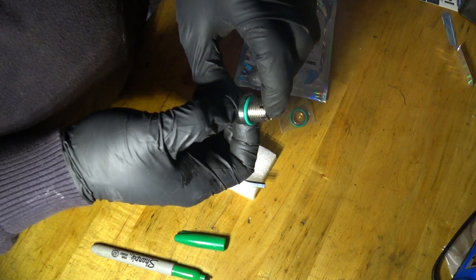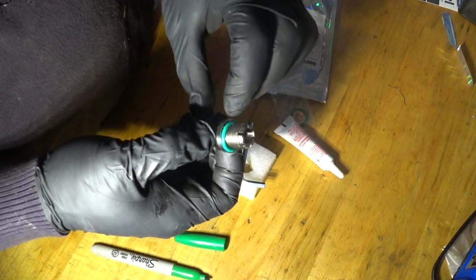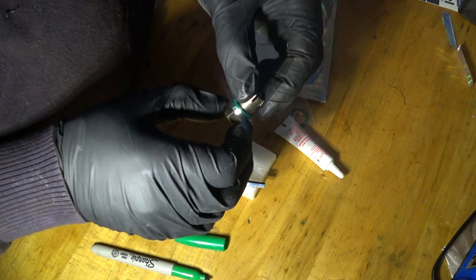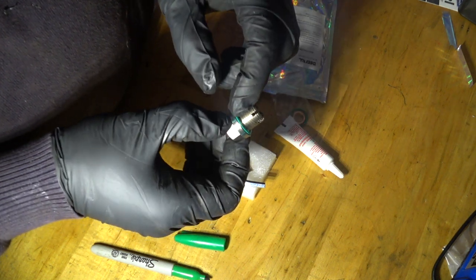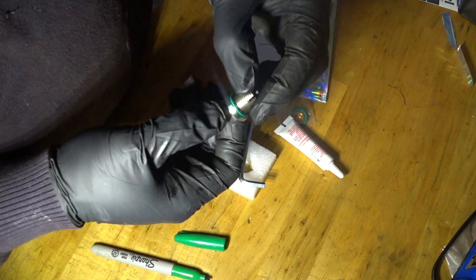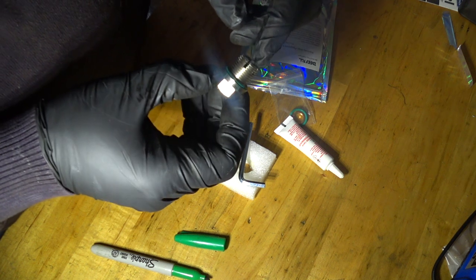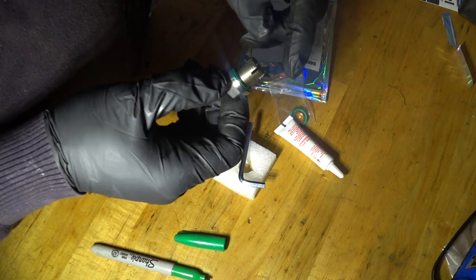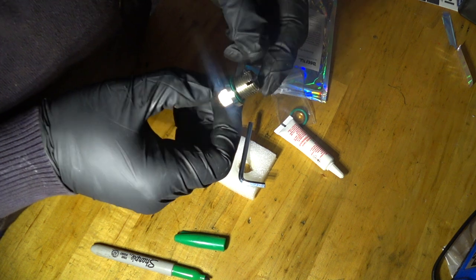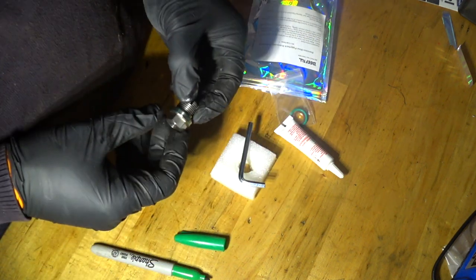So far I've driven 200 miles with the repair plug, and it's been working very well. No leaks, no crack propagation. So we'll see that now. I'm going to replace the oil again just to make sure. Although I did flush initially and cleaned as best I could, because this is a self-tapping screw plug, I'm going to flush it again just to make sure that there are no residues of aluminum material inside the transfer case. So that's what I'll be doing today, and I'll explain more on what I did down there.